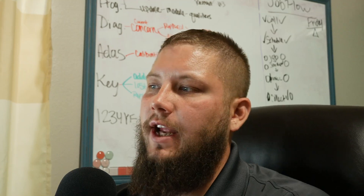Doug says: 'Hey Keith, saw your video on Mazda ABS module programming with the Launch — I wanted to know if I'd be able to do this, but my old module doesn't communicate. Is there any way to manually enter the as-built data?' Unfortunately, the Launch only does a PMI process — Programmable Module Installation — where it talks to the original module, pulls the as-built configuration data, and then pushes that data into the new module. If the old module doesn't communicate, a PMI can't be done with the Launch.